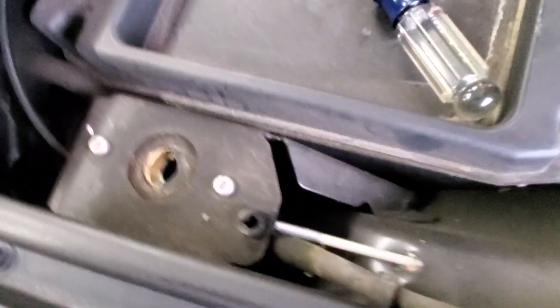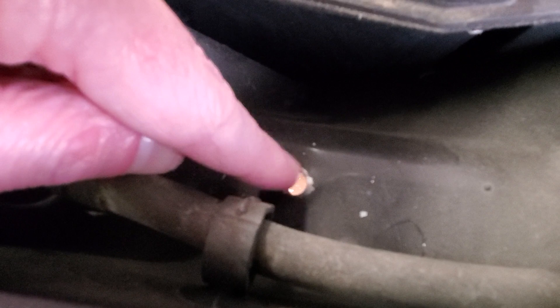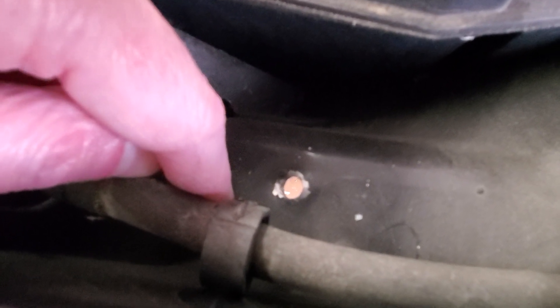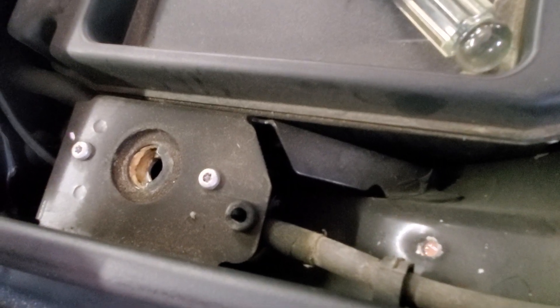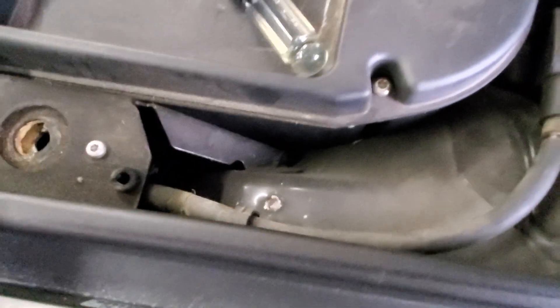Once you're done you can take your fishing rod out of there, get your punch or a little body hammer, and get this grommet back kind of flat to the way it was. I'm going to put a little paint over this — clean it up with some denatured alcohol and put a little automotive paint on it to prevent corrosion, and make sure my fastener still fits. That's how you get the hood open while hopefully causing less damage than the drill bit method. Thanks for watching, please like and subscribe.